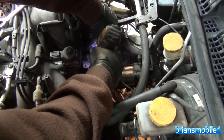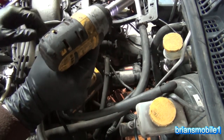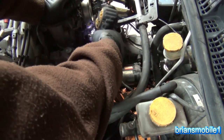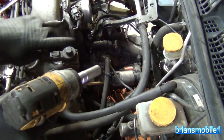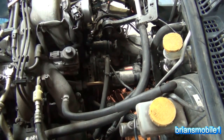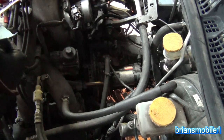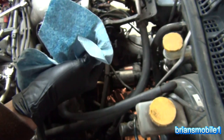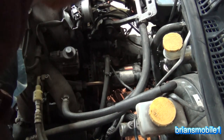I typically treat these the same way as a timing tensioner — on the Subarus they always say get a pry bar and pry it forward from behind when doing the tensioner. It was a hydraulic apparatus, and I try to get it as far as possible so you get the maximum amount of throw allowable — maybe buys you a week or two before it fails. It's just a dumb superstition but it's what I do. I need to hook up the wires again and get them clicked into place.